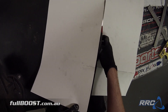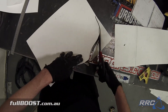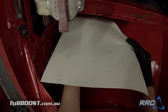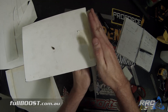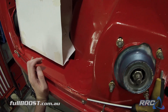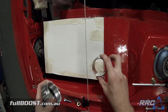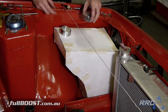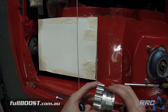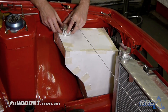After measuring everything up, it's time for our tried and trued cardboard template method. After some cutting and taping, we have our mock-up ready. So we've slightly revised the tank — we've chopped about 30mm out of the top of it just because we wanted to make sure there was definitely going to be heaps and heaps of clearance for everything under the line of the bonnet. More than likely we'll have a filler here, so we had to make sure we had enough room for that. We screw that on and we've definitely got enough room there.